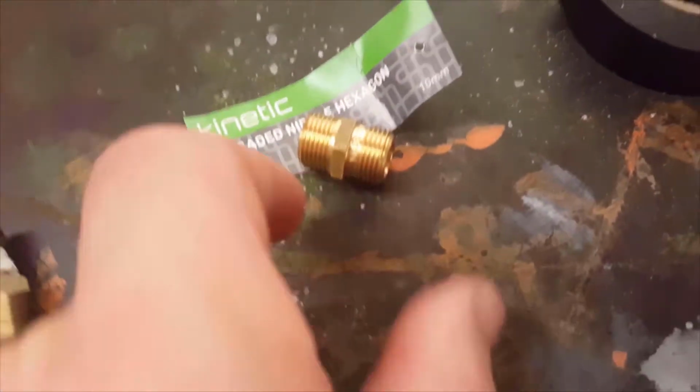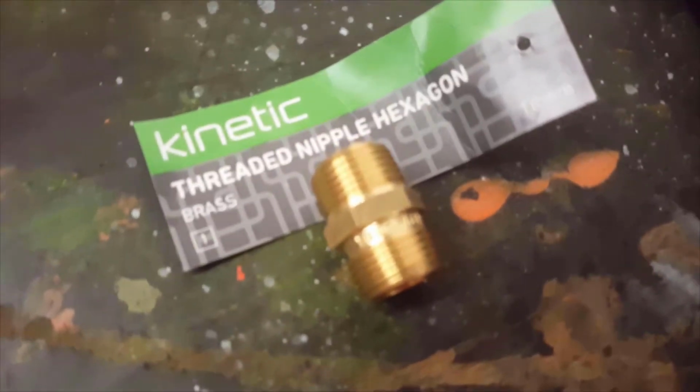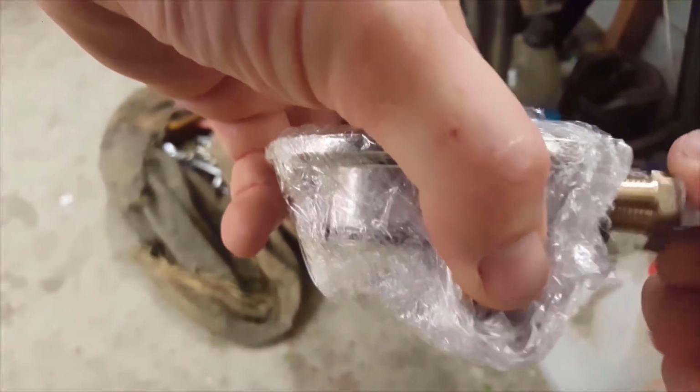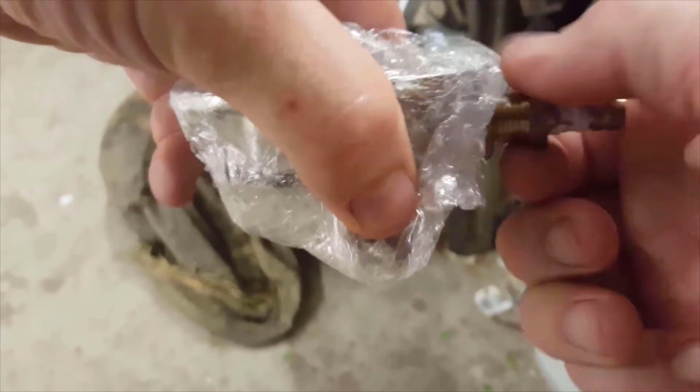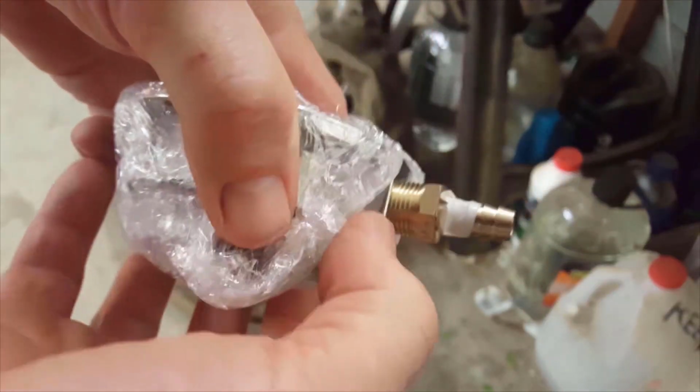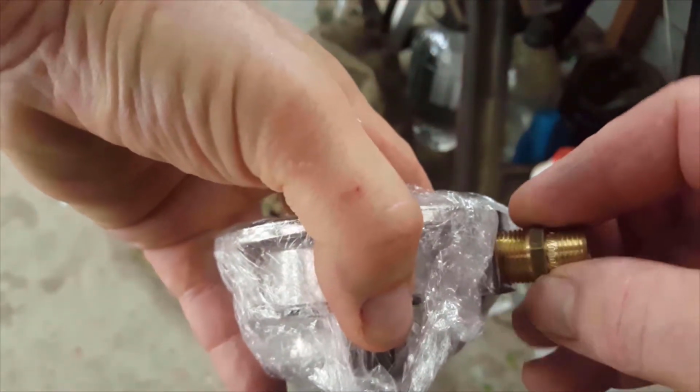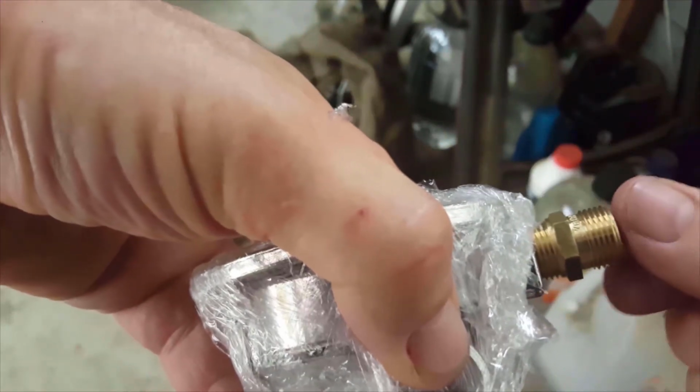One thing I noticed is that this 10mm thread is very similar to the, I think it's 3/8. I'll demonstrate that. Okay, so we've got the advertised as 3/8 fuel connection. We'll call that either the wrong thread or a crush thread. And this is the 10mm. I got it at a hardware shop, and you can see that it's fairly similar, or it's possibly a better match.